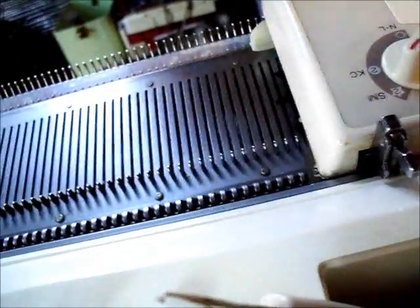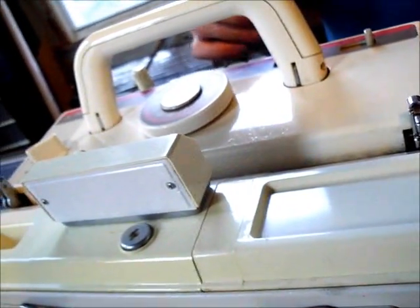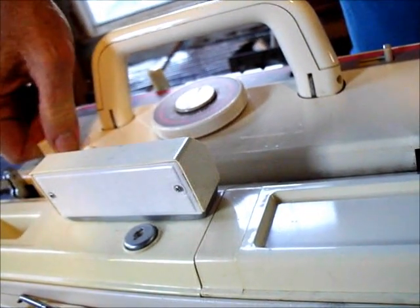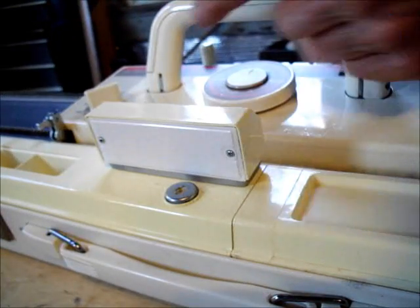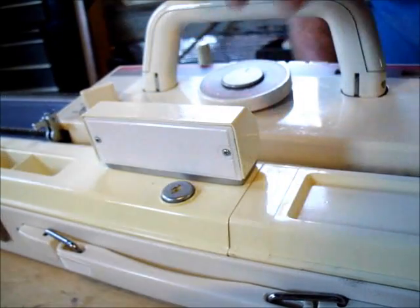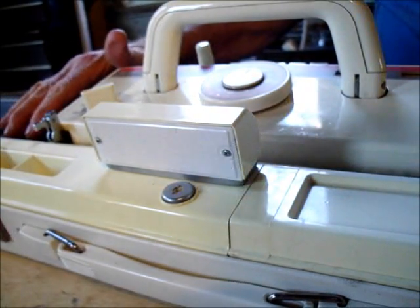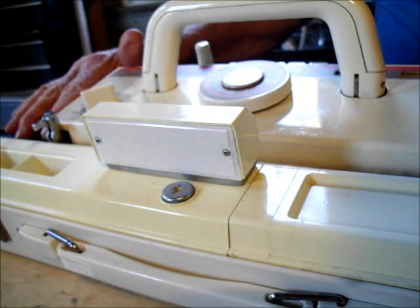Okay, now, the reason we're using the LPS 1 is it will clean and lubricate. Now, that should let that piece retract where it's been sticking. You may have to spray it and really let it soak. The LPS 1 is foaming, so foam it up good. It won't hurt your bed, it won't hurt your needles. You can, or the plastic, you can just wipe it off after. Let it sit there a little bit and let it soak in.